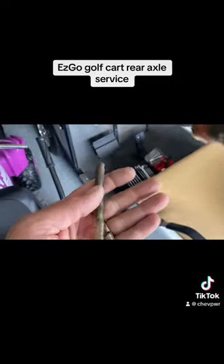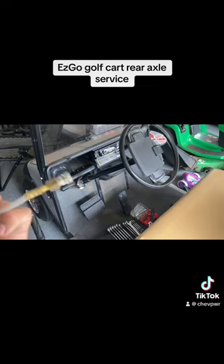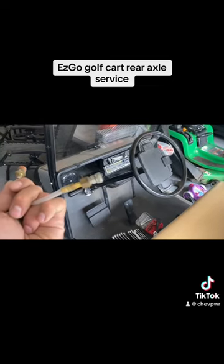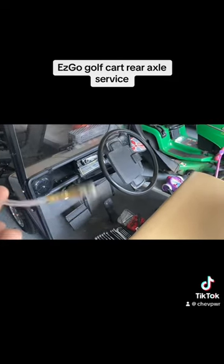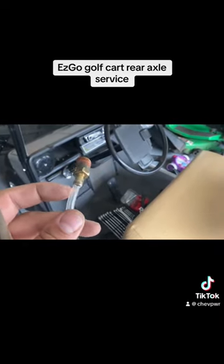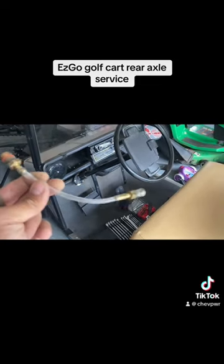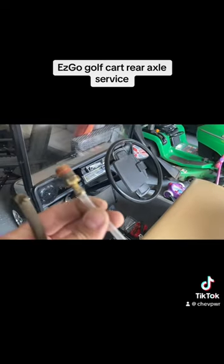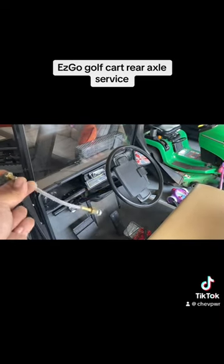First thing that I noticed — I kind of knew about this — so this here was the original hose, and this is a vent hose. This fitting here goes into the axle, and this is basically your one-way valve or your vent. Every axle will have a vent, and there's a little bracket that holds it in place so it doesn't flop around. I knew this was busted, and actually the vent itself — when the hose broke, there was a bunch of dirt and stuff in there, which is not good. So I found a piece of hose. I got it on. I'm not going to use any clamps because I literally used heat to get it over the barbs. And that's pretty much it so far.